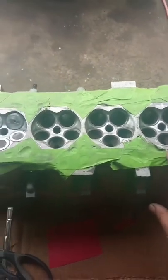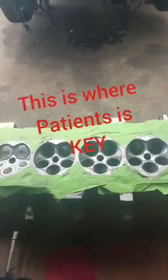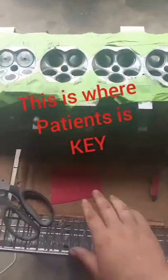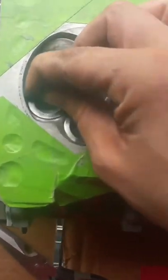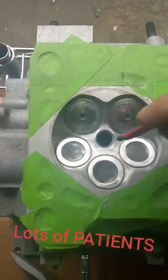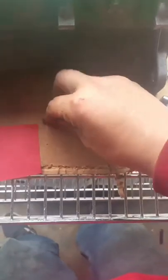It's not too much of an issue on this engine for this build because I am anticipating high boost levels. We're done using the rolls for now and we're going to switch to sandpaper. I got some 220 grit — the paper's not squared, and the reason for that is I like to roll them into tapered rolls to help work down into the crevices and get into those hard-to-reach areas where the pointed rolls couldn't get.